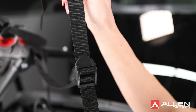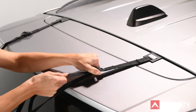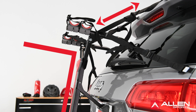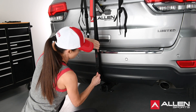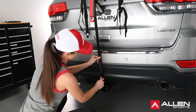You can now install the rack onto your vehicle. Top hooks must be completely hooked over metal edges at the top of the trunk, rear door, or hatchback. Set the length of straps to position the rack with its carry arms inclined slightly upwards. Hook bottom hooks to a metal edge below the bumper or at the bottom of the rear door. Tighten the bottom straps by pulling on the free ends of the straps until the elastic portion of the straps are stretched.